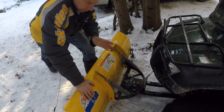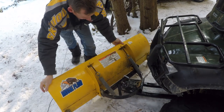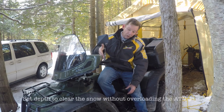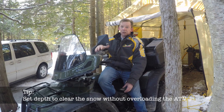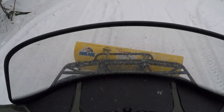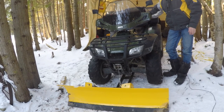If you're pushing a lot of snow or heavier snow, you might want to angle the blade so it rolls off to the side. This one has a manual release — I'll pull that down and turn the blade to the angle I want. When we're all mounted and ready, I'll start plowing. I put it into four-wheel drive and use a nice slow steady speed. I'll put the blade all the way down — I've got spacers on it so it won't dig right into the ground. On really rough or potholed gravel surfaces I might leave the blade up a little bit, but once we get a good packed base and the ground's frozen, I'll put the blade right down. Usually I'll angle the blade and start with a pass down the middle, then come back on one side and down the other.